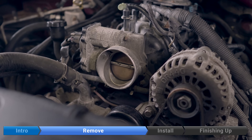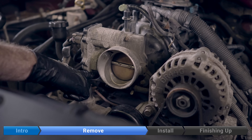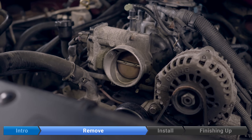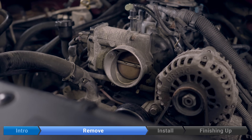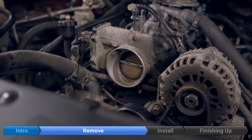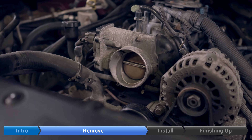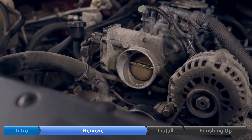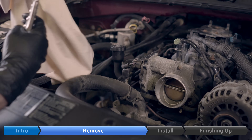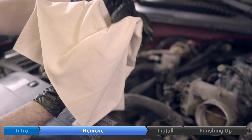On this step, we're going to have to remove the coolant line that runs through the throttle body. It comes in on the left — there's a hose clamp — and then there's an outlet hose on the right with another hose clamp. You can basically just put down a rag and pull them off; you're going to lose about half a cup to a cup of coolant. Alternatively, you can use those fancy pliers for pinching off hoses. I'm going to use vise grips with a rag in between the teeth so we don't have bare metal crushing down and tearing the hose.